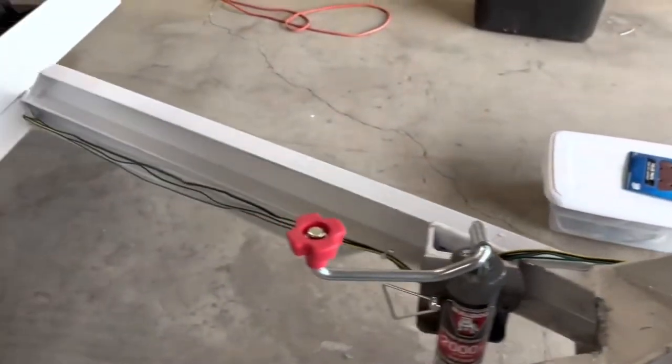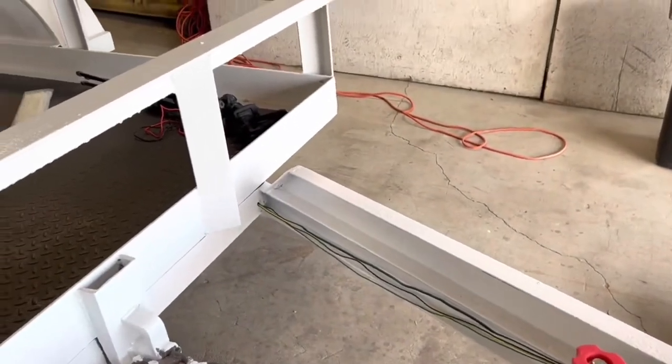We're inside the barn now because it was getting uncomfortable laying on the rocks. Let me show you — we have a brand new wire harness all the way back to the lights. Only took me three hours. And it wasn't the trailer — it was the truck to begin with. It had two blown fuses. Note to self: if it stops working, check the fuses on the truck too.